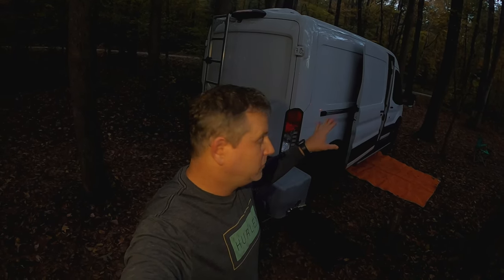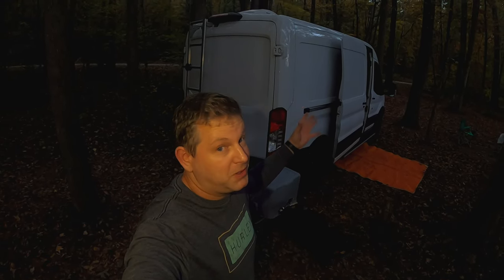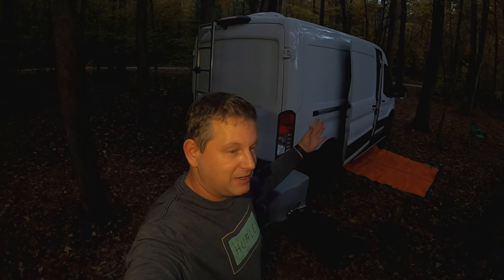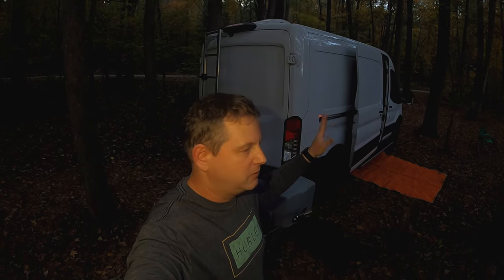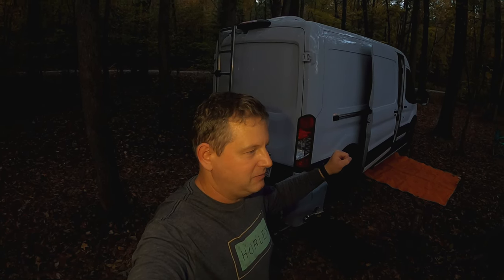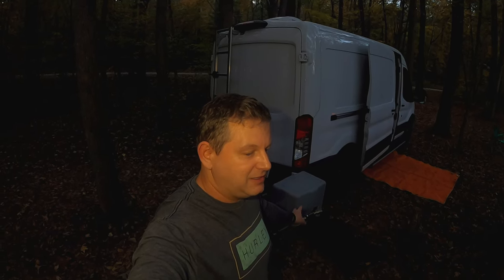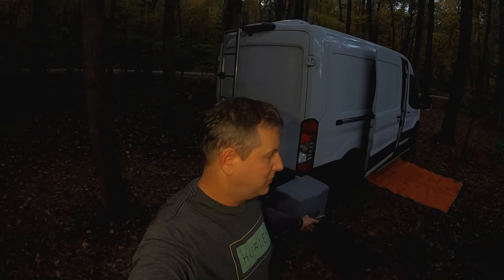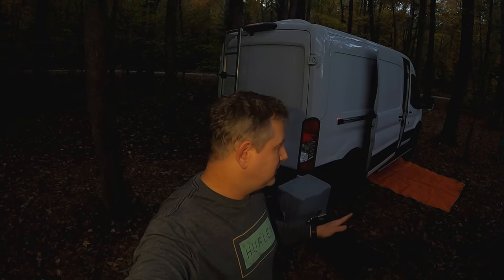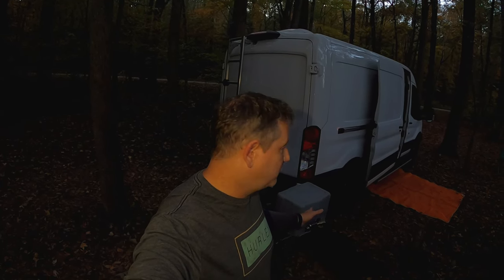Used to, when it got cold, what we would do, we'd turn the propane heater on in the inside. Yeah, the problem with that propane heater is, first of all, you're burning up your oxygen inside the van. So you gotta make sure you've got your windows cracked quite a bit on each side. It's a little buddy heater, and you go through one of those small cylinders of propane in probably 3 or 4 hours. And this diesel heater, I ran it for 7 hours the other day, and it probably used a fourth of the tank that's in there. I don't know exactly how efficient it's going to be on the lower level, but we'll see. I'm guessing we could probably get at least 2 nights out of that small tank that's in there.